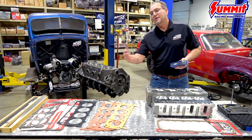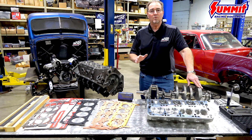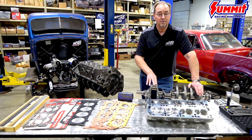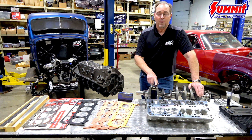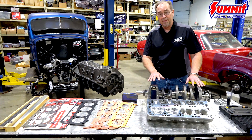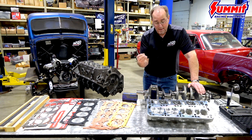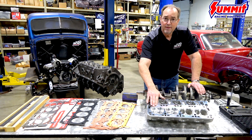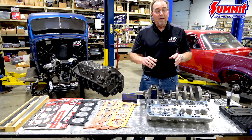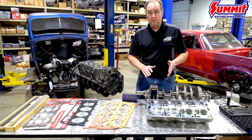In a minute we're going to show you an extreme — about a 12 or 15RA, very very smooth. What we've done now is measured this billet crankshaft, which is a really high-dollar piece, and the journals on this crankshaft according to the profilometer give us a 15RA. Most of you assembling engines will have a block, a head, and a crankshaft in your shop. So to give you another visual: that's a 15RA, this is about a 22-23RA, and over on the block we've got about a 60RA finish. Now you can begin to quantify what your surface finishes need to be for a certain type of head gasket.